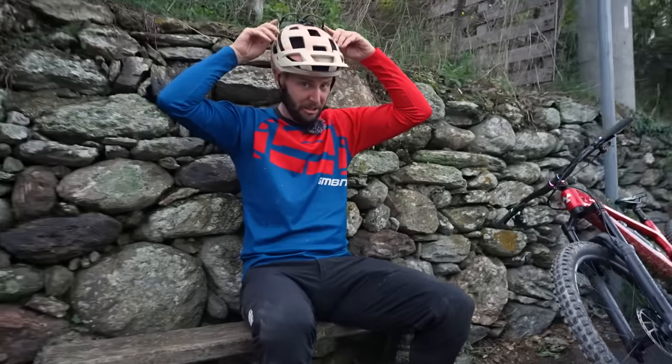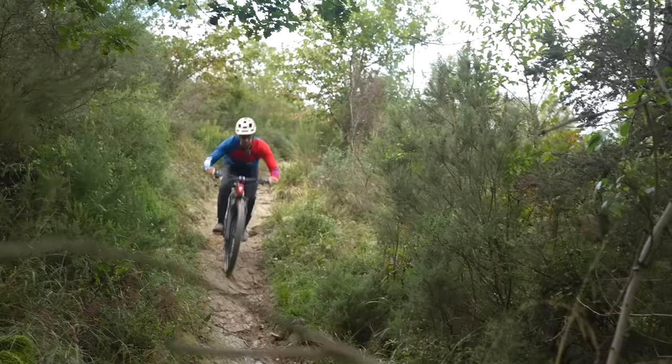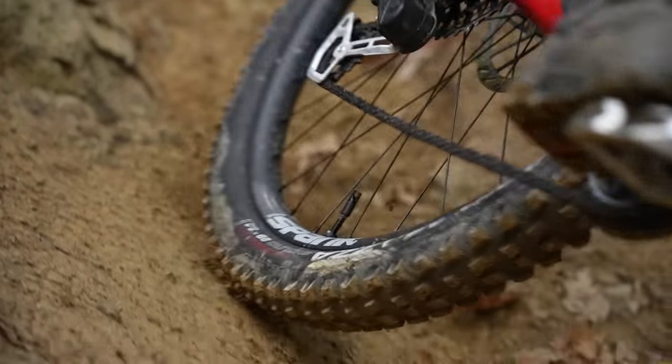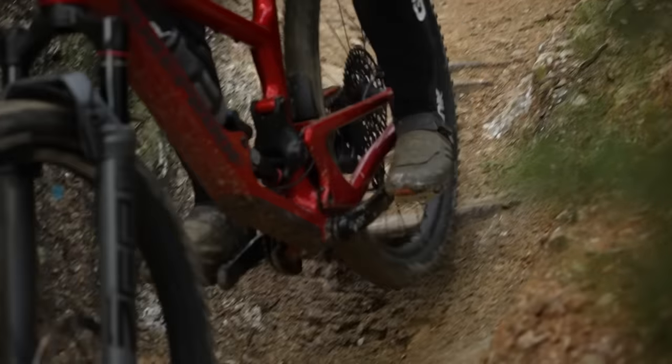That was three very good runs at three very different tire pressures. Does tire pressure matter? Yes, hugely. The first run didn't feel as fast — it was a bit skittish, the bike felt very lively underneath me. The second run on my base pressures felt like a really good run — very comfortable, a great compromise between grip and protection, though I did still get a bit of a ding on a really rocky trail. Then onto the third run with the softest pressures — holy smokes, the grip was way up there to a degree, but on certain corners it was rolling, and on that last rock garden it was just ka-tong, ka-tong. I was riding with a fear in my mind that I was going to break something — it's almost worth eliminating that and running them a little bit firmer.